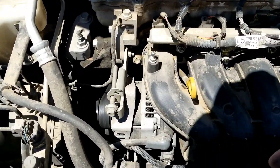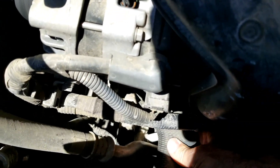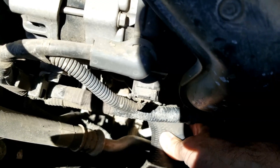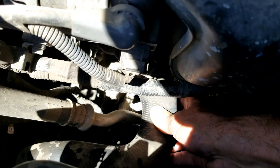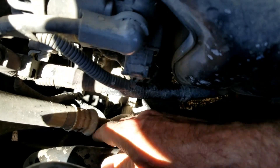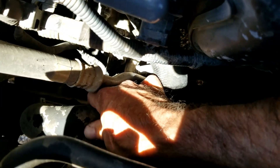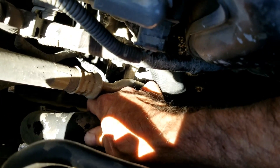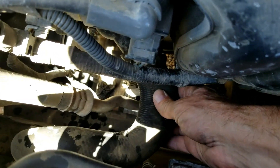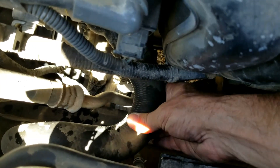I'm back and the engine's warmed up — it's been running for about five to ten minutes. I'm just going to feel these hoses, and yeah, I can feel the coolant now flowing past there. Sometimes this can be a little bit hard to feel, but you can feel it because it's flowing in the hose. When you squeeze the hose, I can feel it right there — I could definitely feel it flowing through there. That thermostat is open and it's flowing.